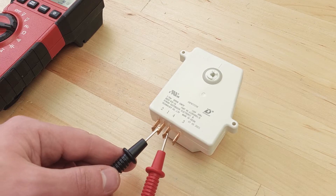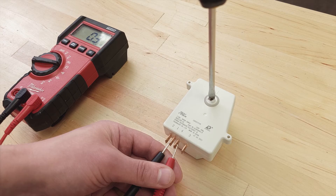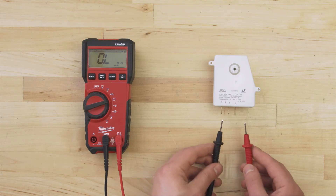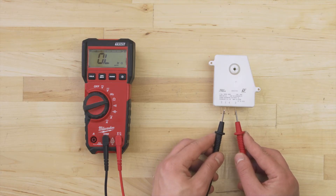To test the cooling mode, check terminals 1 and 4. The cooling circuit will be energized for the majority of the time, so you should get a continuity reading. Turn the advancement screw until it clicks — this should disconnect the circuit, so there will be no continuity. If the defrost timer fails any of these tests, it's faulty and should be replaced. Keep in mind that testing terminals 1 and 3 might not show a normal reading, as the motor uses a small capacitor. This means in most cases you can't check the motor. If you think the motor has failed, replace the defrost timer.